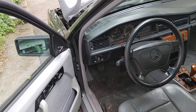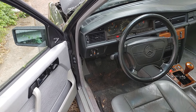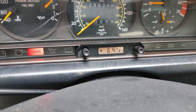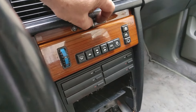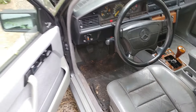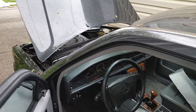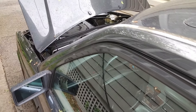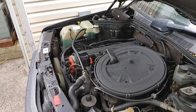See, it gets quieter. I put in a little bit of Lucas oil stabilizer and 40-weight engine oil with a new filter. Lifter noise is still there. And I got my outside temperature display — it even lights up, that's cute. I also bought a replacement fan control knob. These noises just suck. I'm waiting for the lifters — they'll be here soon, probably Monday, and I will replace them as soon as possible.